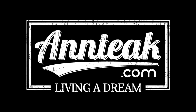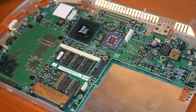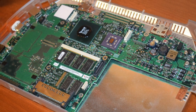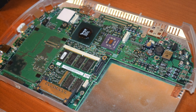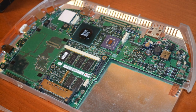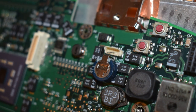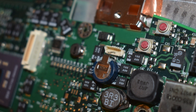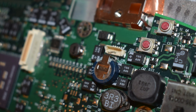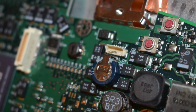Frustrating as it is, I have had to take the machine back apart again. I've got it all the way back down to a motherboard, and what I've discovered is exactly what I suspected. The backlight plug that pushes into the motherboard, which I've described as being particularly tiny, has actually got bent pins in it. That's me when I've pushed the connector back in. I tried straightening the connectors, but my first attempt ended up breaking a pin.